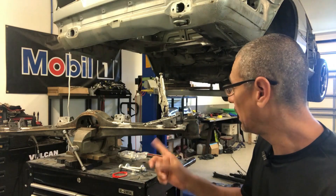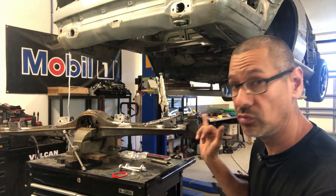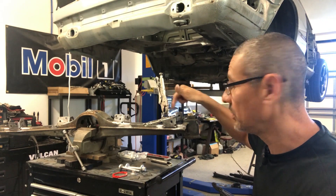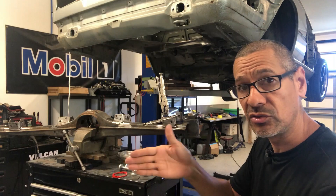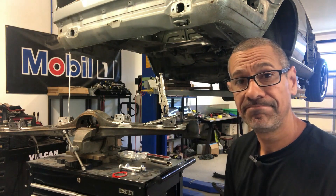Before getting to tacking, I went ahead one more time and made sure the whole subframe was level, and then made sure each one of these is level as well so the adjustment is going to sit flat.